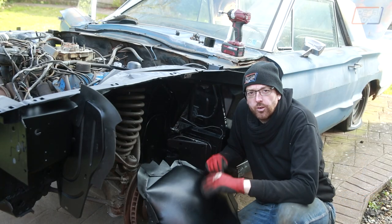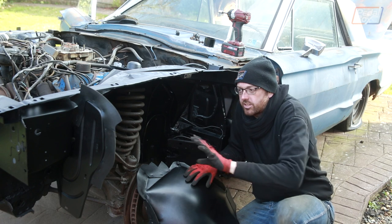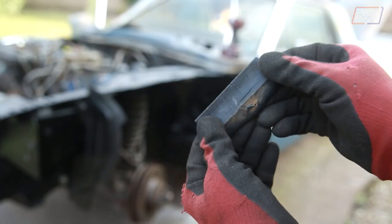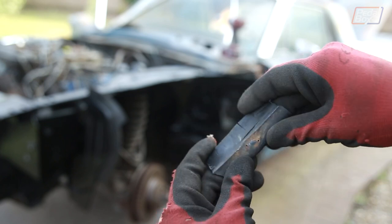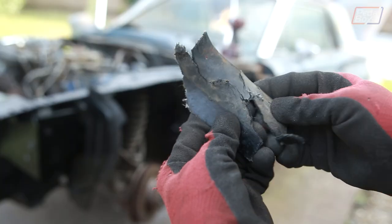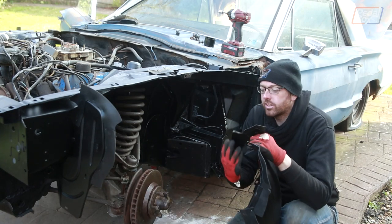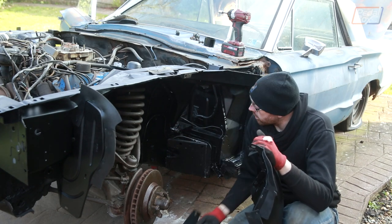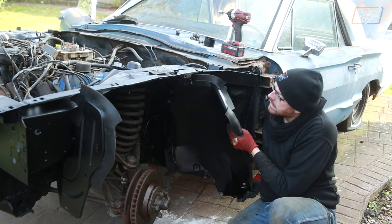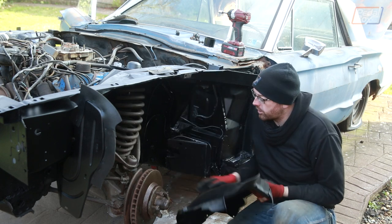Skip forward a couple of weeks when it's a little bit warmer outside - we finished fitting all of the splash guard seals onto the front and rear splash guards indoors. We did those on the live stream so if you haven't already, do check those out. These are the original pieces we took off - some of them are rubber and they bend just barely, but they crack pretty badly. Some are actually quite fibrous when they dry out, so it's not quite the same as this more neoprene-style material, which should hopefully last a little bit better. This one has two pieces that go back on - a tiny little plate that fits in the gap under here and seals off the inside of the arch right next to the spring, and then the main piece goes all the way up to the outside edge of the fender.